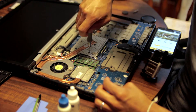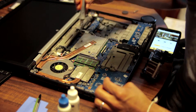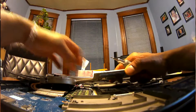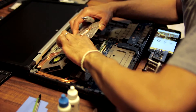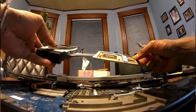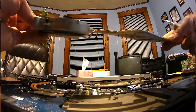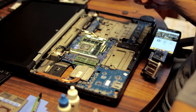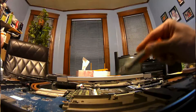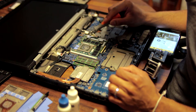While unscrewing the heatsink, I like to follow the order listed on the heatsink itself: unscrew one, two, then three, then four. You don't have to do it that way when taking it off, but that's just something I like to do. Now that we've taken off the GPU, make sure you unplug your fan. So far it looks pretty clean — a little too much thermal paste but not too bad. The pads are stuck on there and I'm going to replace those. If you haven't seen a GPU before, the center is the GPU, on the sides you've got the memory — those black squares — and then you've got your voltage regulators.